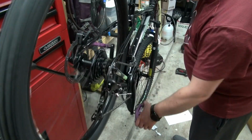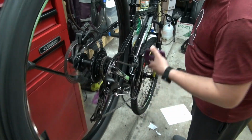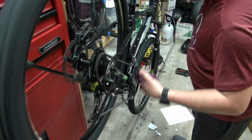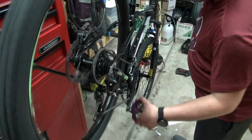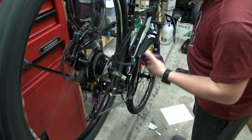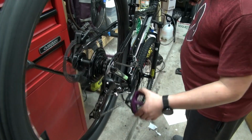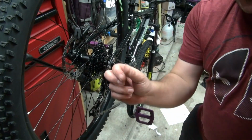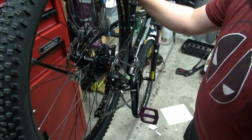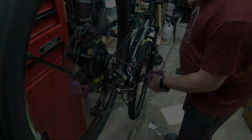Okay, I'm gonna go ahead and micro adjust. First. That's first, second, third, fourth, that was my bad, fifth, sixth, seventh, eighth. No issues going down, 7, 6, 5, 4, 3, 2, there you go. All I had to do literally was the barrel adjustment up in the front between first and second, turn it like 1.5 full turns, and that took care of any shifting issues.